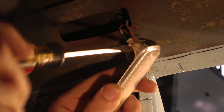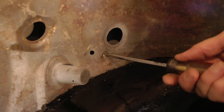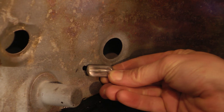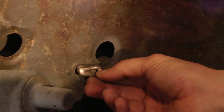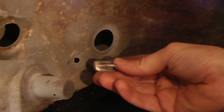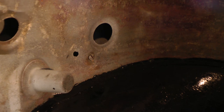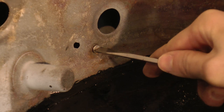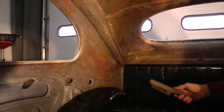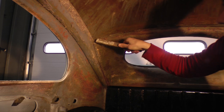What we're going to start doing now is disconnect the dome light, take off more of the old padding, and then start re-padding the car. Here's another spot that's common on early bugs — there's a hook right here that holds the backrest in place so it doesn't fall forward. Just make sure there's a screw in the frame there to hold the strap. Leave the screw in the body so you can feel for it, cut the material, take the screw out, and put the hook right back in. Now I'm just going to start scrubbing some of this old padding material off with a wire brush.